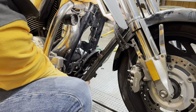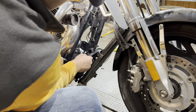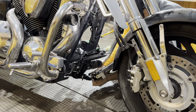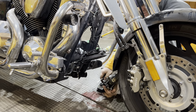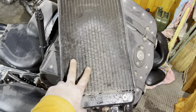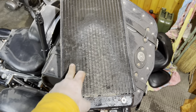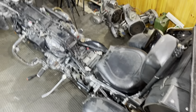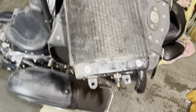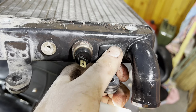This is the coolant cap. There's a drain bolt around there, so I use a long extension to unscrew it. It starts to drip coolant — I'll just let it drain. There's still a lot of coolant inside, which is a good sign, and it's clean, which is also a good sign.